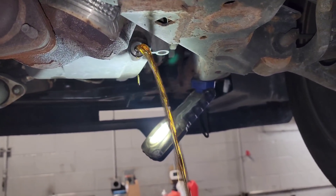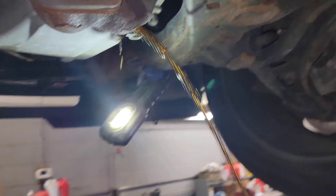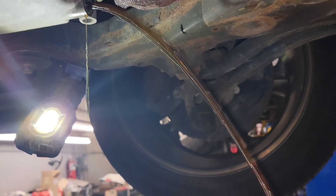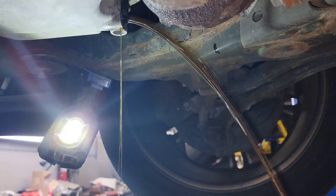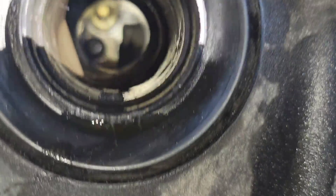This BG engine restoration dynamic kit works well — it's the best stuff on the market. People often say you should just run diesel or kerosene through it. They do have something called Motor Flush — it's a red bottle at Walmart and some parts stores, it's straight kerosene and diesel — but it does not work anywhere near what this works, not even close. It was fine when there was a lot of buildup inside the motor but now it looks like it just needed a good cleaning. They'd already had timing chains and phasers done, so it was just junk and sludge inside the motor.